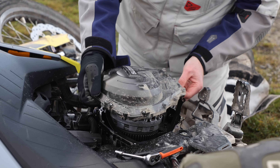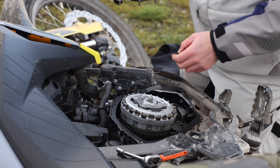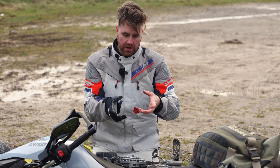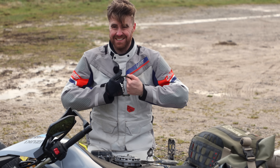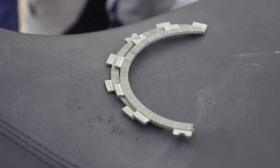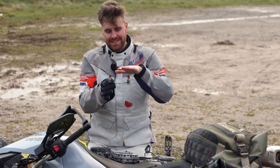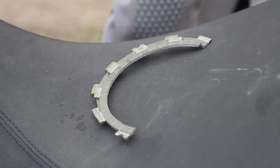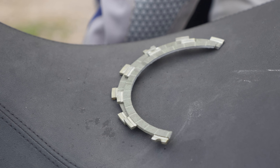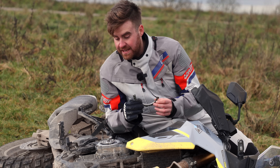The goal is to now make the bike a fixed drive bike, so effectively it doesn't have a clutch. To do this, I've taken the clutch cover off the right-hand side of the bike and exposed the whole clutch mechanism. What we actually need to do is take one of these fiber plates and snap it in half — that's horrible. Now that we've done that, what we're going to do is take this broken fiber plate, put it together in a little half sandwich, and put it into the clutch, and that builds the stack height of the clutch back up. The fiber plate you choose to snap in half needs to either be one of the plates that's already in your clutch or be a plate you then replace in your clutch. If you try to add an extra fiber plate to the clutch pack that's already snapped in half, you are never going to get it done up again.